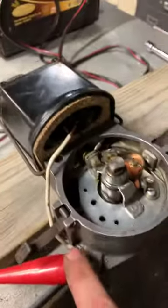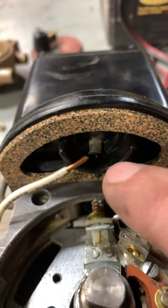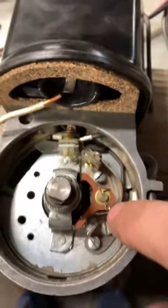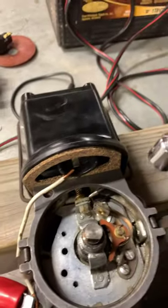Next you want to have a little ground wire with a small gap, almost acting like a spark plug, to check for a spark. I set my point gap at 15 thousandths, and everything should work right now.